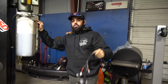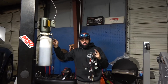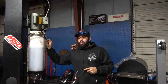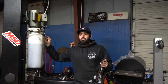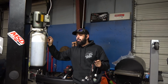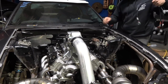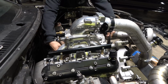I mean, it works. So we had a discussion. If you look at a Holley harness, the red wire on every injector is on the right side, and we were like, is that important? I didn't know, so we did some research, and it actually is not. As long as it has both wires up to it, a trigger and a power, it'll work, which I think is pretty cool. I was like, oh god, I messed the first 3 up, but we're all right. So we're back on. Got the flat Mickey Thompsons back on there. I've got to tighten up my oil pressure sensor.